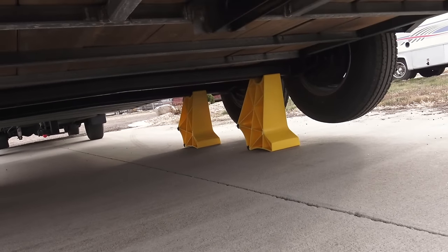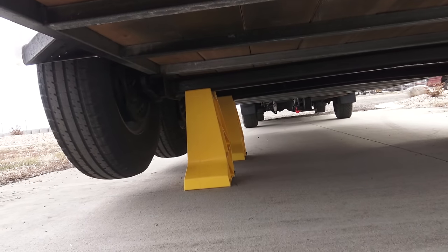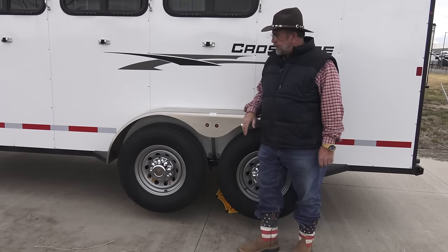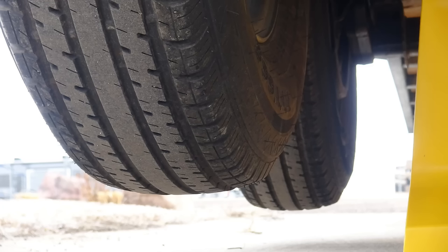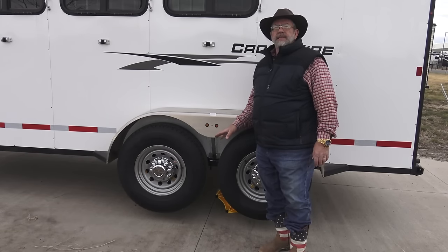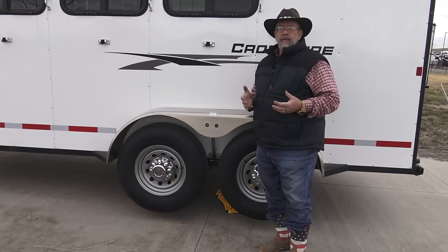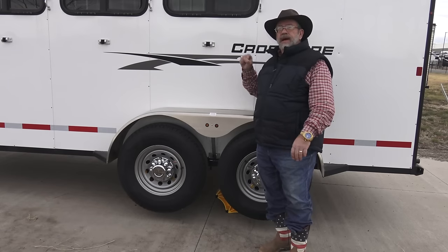That is the coolest thing you'll ever see. We've done it — we put the trailer legs on and backed up, and here we are, we're off the ground. We must be almost five inches off the ground. That is so awesome — check my brakes, do it all, and it's ten minutes and I'm in the air. A lot of times these trailers will sit for half a year or more, and that weight sits on the tire, makes those cords separate, and then you have all kinds of problems when you start using your trailer again. When you're really not expecting it, the front of that tire will just blow out.